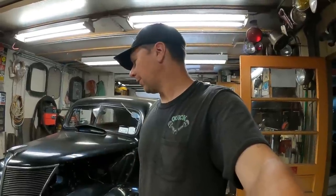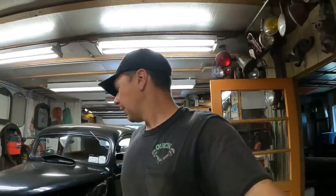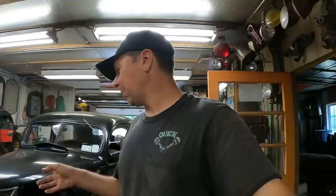I messed around with this thing off camera about 7 hours yesterday. It had quit from the last video when I did the first drive. If you saw the first drive video, I finally figured out that the condenser was bad, so I put a junk one I had on there, and I got it running. I don't think it's running 100%, but it's running good enough where I'm able to take the thing out and drive around the block. So we're going to do that.